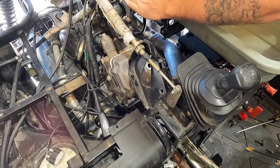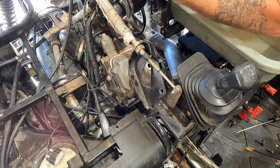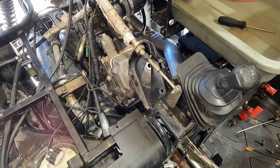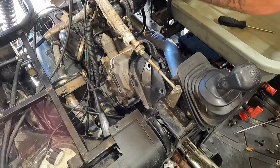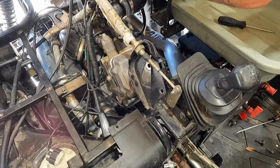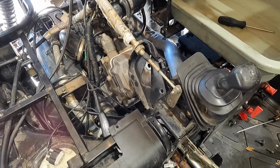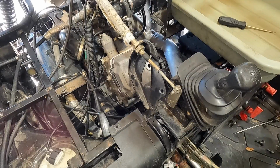And we'll take a look inside that throttle body to see what it looks like too, make sure it's all clean. And I'm gonna go ahead and loosen it right here too, just in case it does want to come apart. I'm probably just gonna leave all the fuel lines hooked up to it. Could take the injectors and fuel lines off, 5mm on these guys. But I'm gonna see if I can just go ahead and take this off with the tins. Let's grab my tin here.